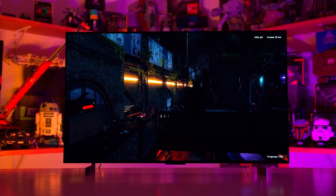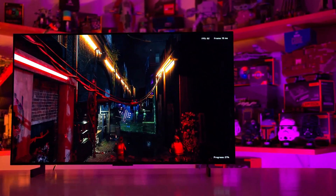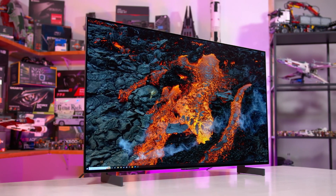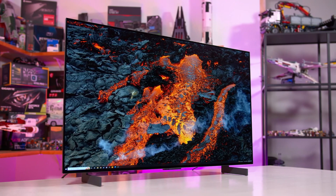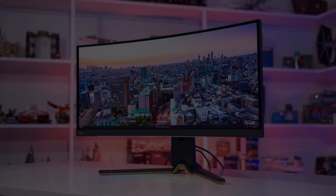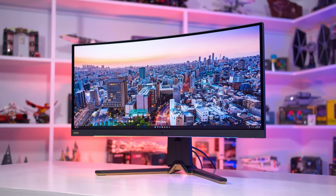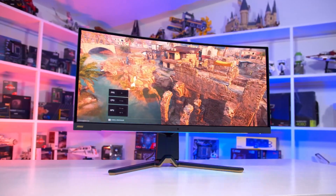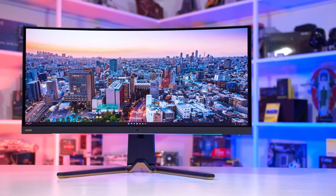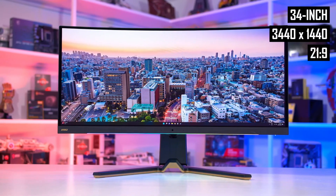The contrast on these monitors is slightly different — at first I wasn't sure if I should mess with it, because normally increasing contrast makes blacks milky and washed out. But in this case it simply adjusts brightness of the whites and overall brightness, which is technically what you need to be adjusting. You also want to go through the gamma settings and figure out what works best for you. I have a video playing in the background so you have something to watch rather than just listening to me talk on a blank screen.